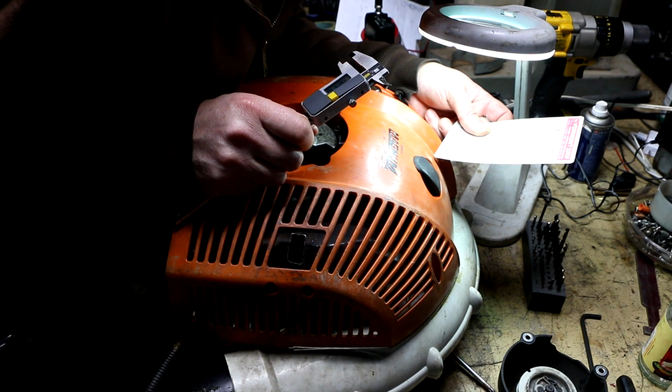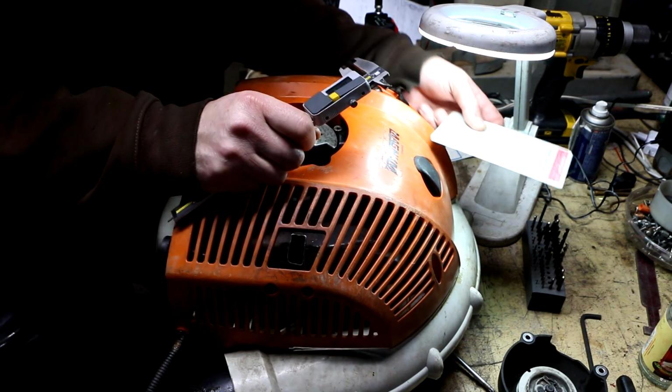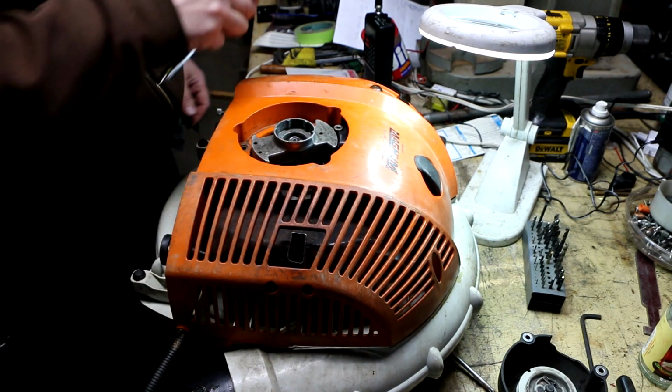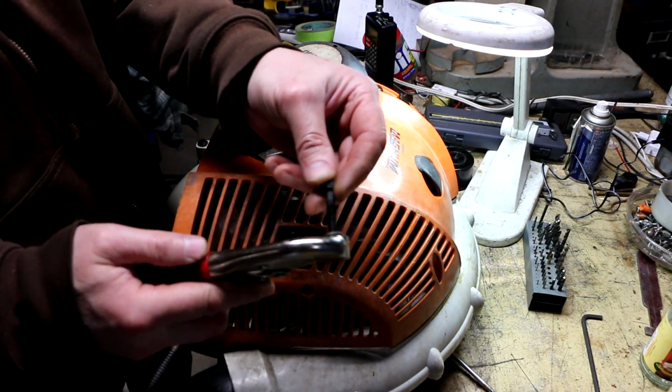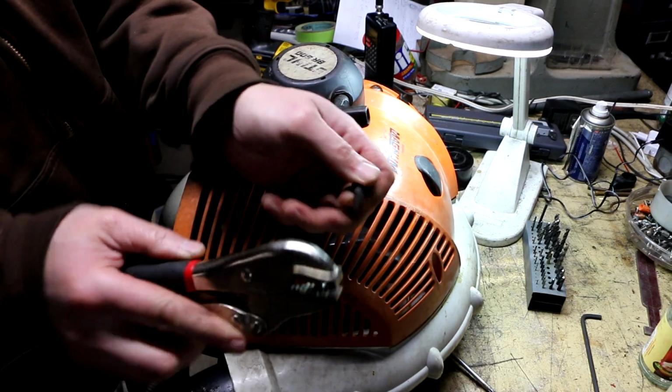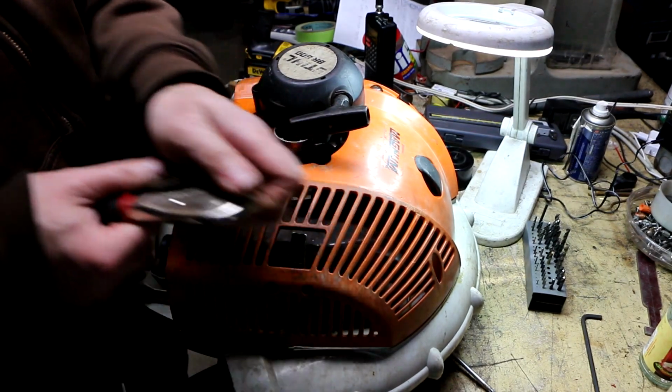Next size up is a 0.238, which is a 6.05mm, which is a B size letter drill, which I probably have. Yep, B size drill did the trick. Large enough to let this screw pass all the way through, but still left a little meat on these bushings.